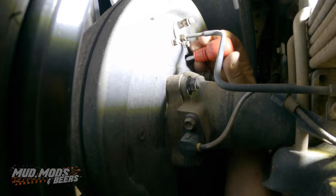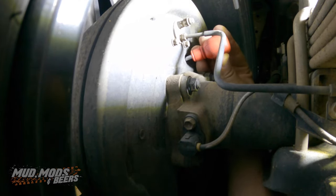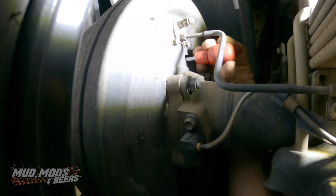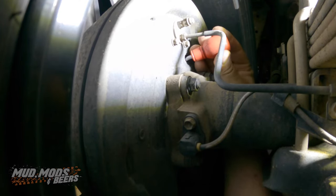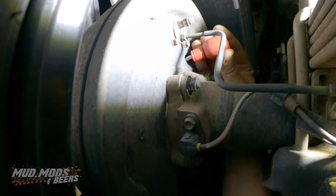To do this properly you're supposed to have jacked the wheel up off the ground so that it spins. You're supposed to tighten this up until the wheel just starts to grab on the drum. I used to do it that way and that way is definitely the more accurate way to do it. But I've sort of got a feel for this now where I just tighten it until I feel that it's tight enough. You can always check it with the handbrake and pull it up. I don't lift the wheel up anymore — I just do it this way.